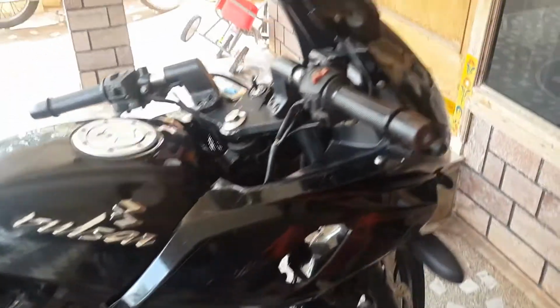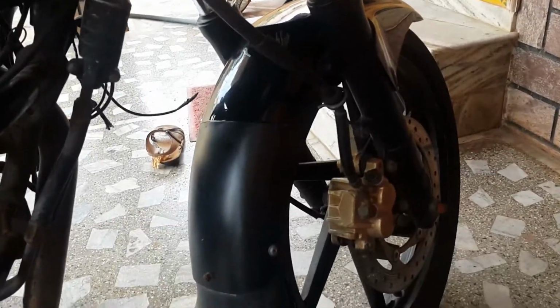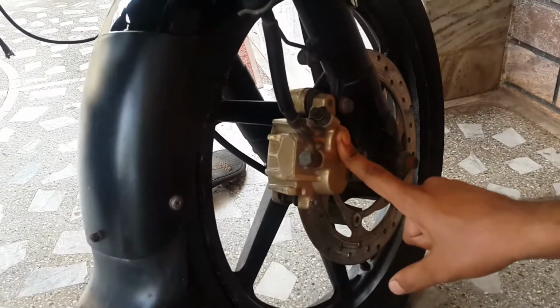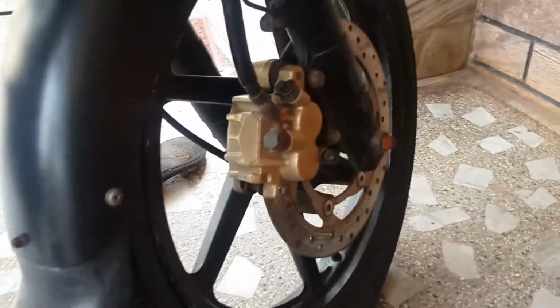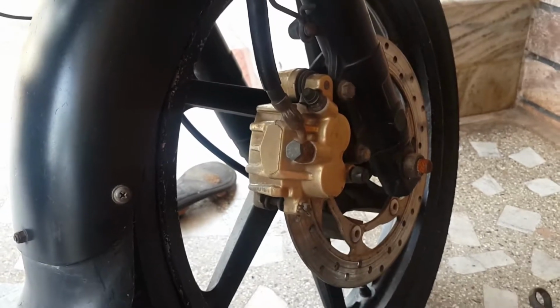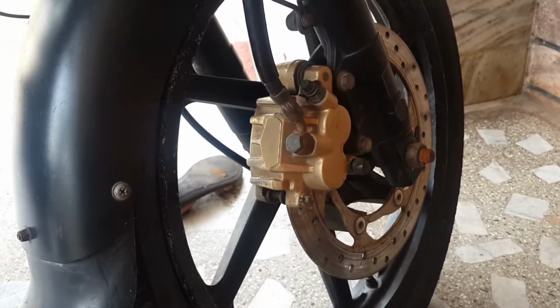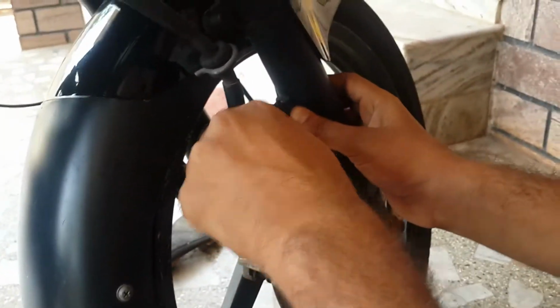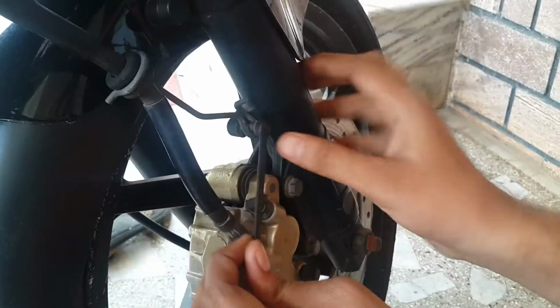So this is the Pulsar 220, which is a 2011 model. In this video I am gonna clean these brake pads. Actually, these brake pads are making a lot of noise and the wheel is also very tight, so that's why I am gonna clean this. So first unscrew this 8mm screw